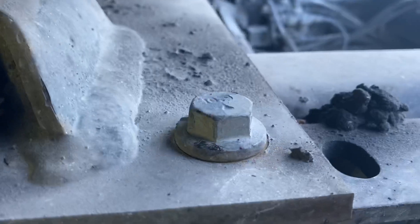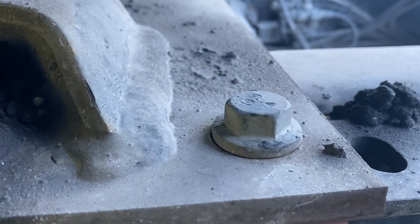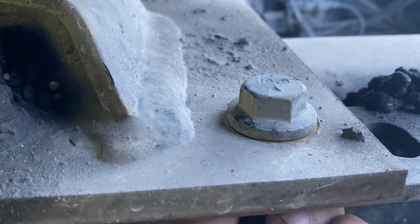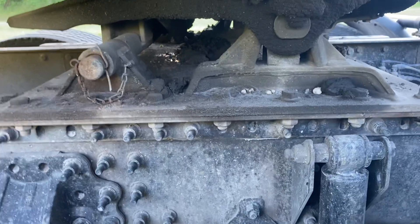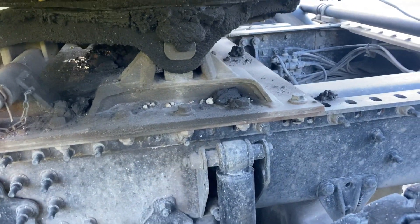See how we can see a little bit of dry powdery rust in there? That's usually a pretty good indication that as it's going down the road, this has loosened up and it's sitting there spinning. So you can see we've got a violation — we've got one loose bolt on this fifth wheel mount.